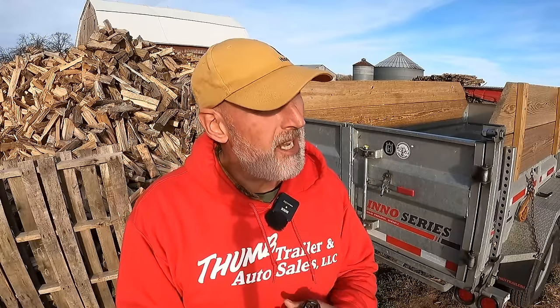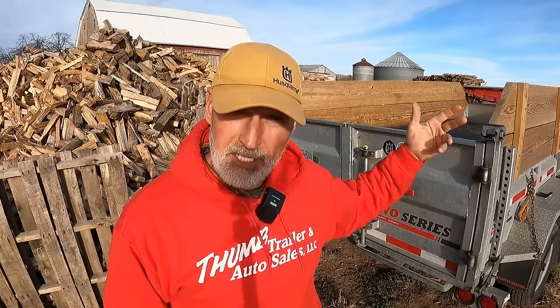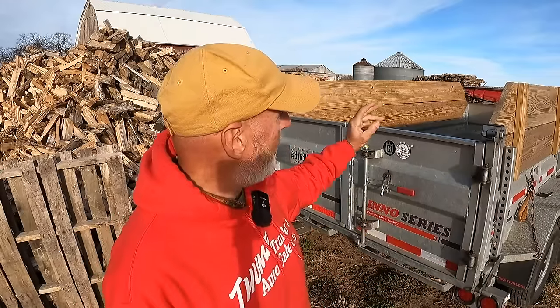I used to have a quality steel trailer, which was a nice trailer. It was a deck-over and it was a 6x10. This one is a 12x6, a little bit longer, and tandem axle like my other one. My other one was only a 7,000-pound trailer with 3,500-pound axles, and after subtracting trailer weight I could only haul about 5,000 pounds. This one has twin 5,000-pound axles, so I have a load capacity of about 7,000 to 7,300 pounds.